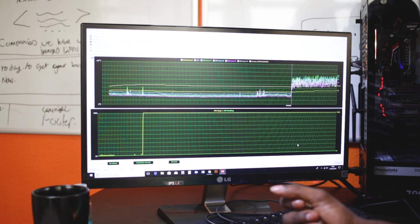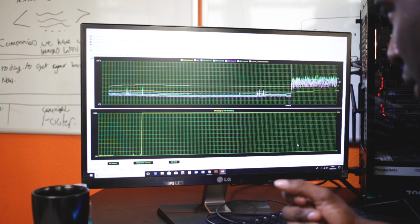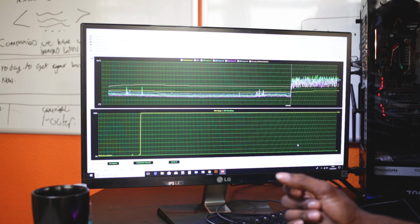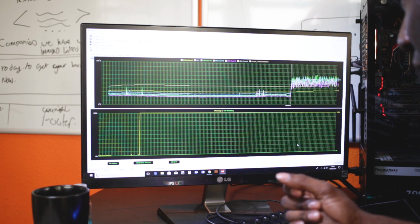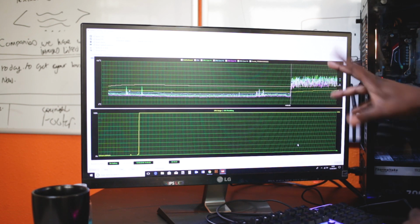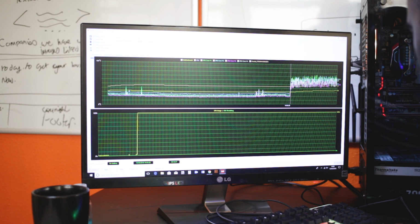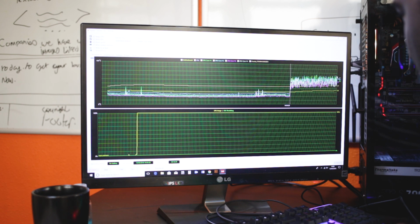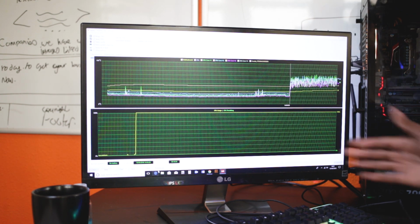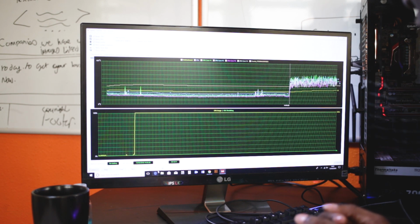Right, so far we've gone up to, well, we were at 69 just a second ago. So we've got CPU 1, CPU 2, CPU 3, CPU 4: 66, 64, 60 and 63. No, actually, and 52. So it's jumping about, but it's not that bad. It probably reached about 70 degrees maximum, wherever it's had a heat spike, but everything's okay. There's no CPU throttling, so that CPU cooler is a recommendation, and I think you should get it.